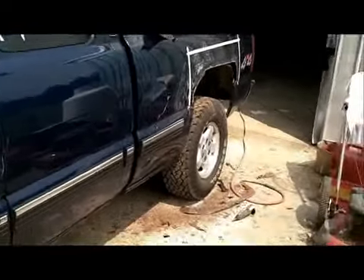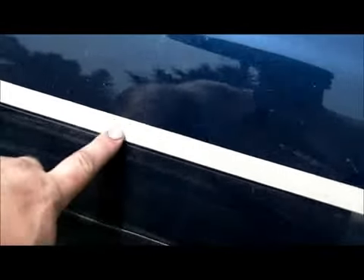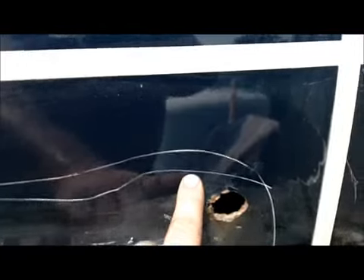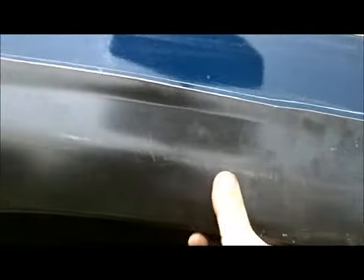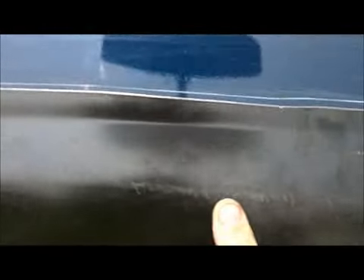We're going to start trimming up some stuff. So I took the panel and I cut it down to what I needed. Now if you look here, you can see what I showed you earlier. What I did is I scribed into the metal here, and this is actually what the panel is now. All that area there — we're not going to have to go all the way up to the top of this box side for body filler now. That's going to save a lot of work. So what I'll do now is grind the affected area and we'll go ahead and put some tack welds in this panel. Then we'll start making something for this area.